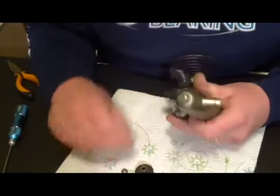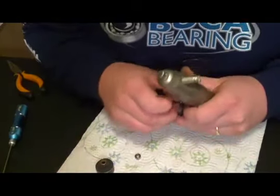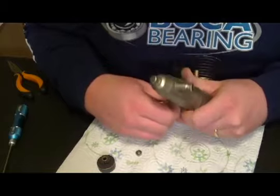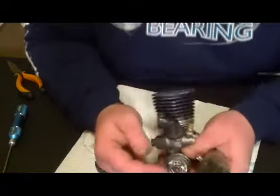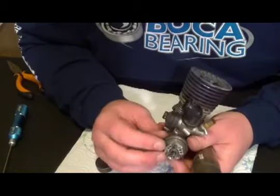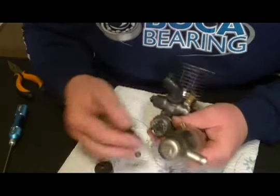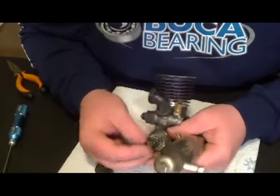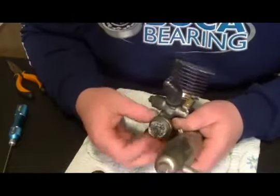I'm going to take the clutch bell off and remove the bearings. What we're going to look for in our clutch bell — these clutch shoes have a few races on them — is mushrooming: major issues where it looks like stuff's hanging off and could potentially drag on the inside of the clutch bell. These all seem to be looking pretty good and don't seem to be too out of place. I'm going to double check the springs, just pulling them a little bit to see if they all come off. They all snap back into place where they're supposed to.